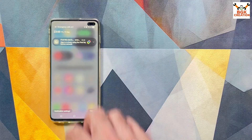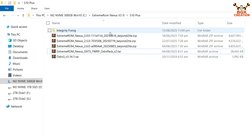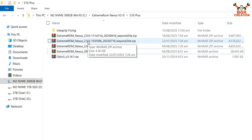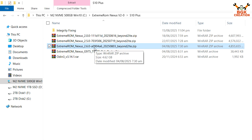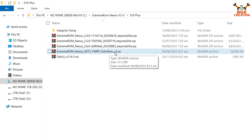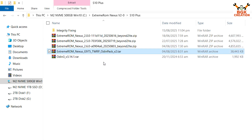Power off the mobile phone. In my downloads folder I have Extreme ROM Nexus 2.0 and 2.5 already downloaded, but I will go straight to updating to 2.6, which is smoother with very minor bugs. We need to download the Odin pack according to the model — Galaxy S10 Plus is G975. Download the TWRP Odin pack version 2, then flash v2, and then flash 2.6. All links are provided in the video description.